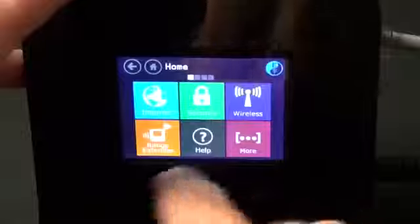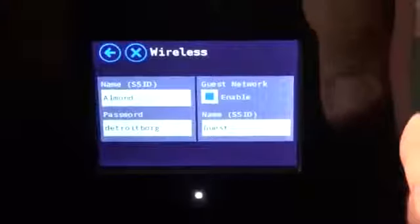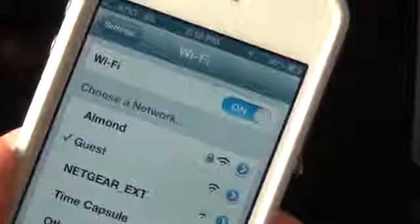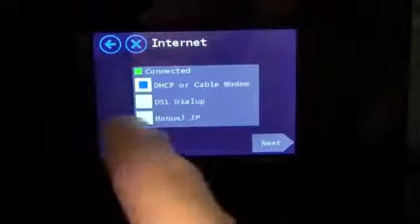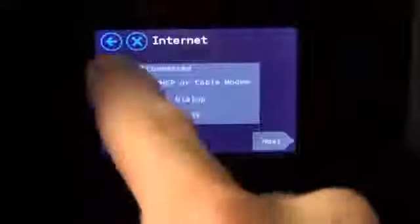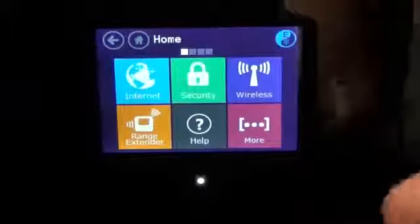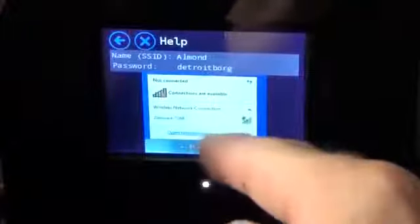I don't like the name of that network, so let's go to Wireless and change it to just 'Almond.' You also have guest network options — go to Wireless, enable a guest network, it will restart the device, and you can name it anything you want. Once it restarts, you'll see the guest network on your device and can log in without a password. Under Internet you have further options for modifying your connection — DHCP for cable modem, DSL dial-up configuration, or manual IP. So you have a lot of options to configure your network directly on the device. Tapping Help gives a little tutorial for Windows or Mac users on how to connect.